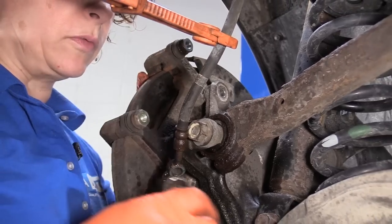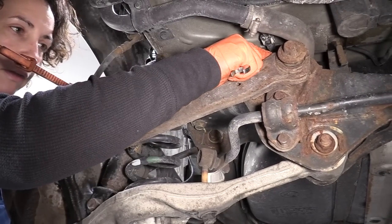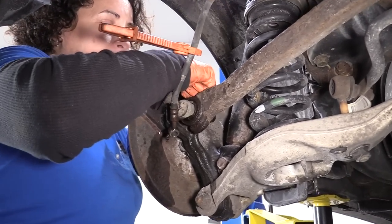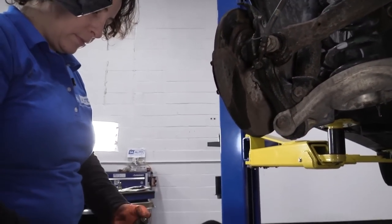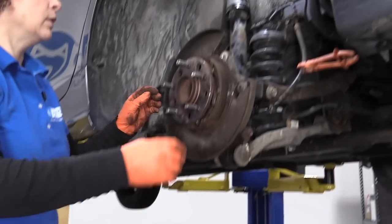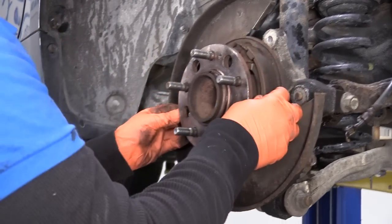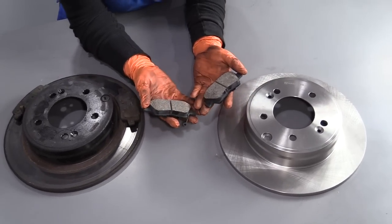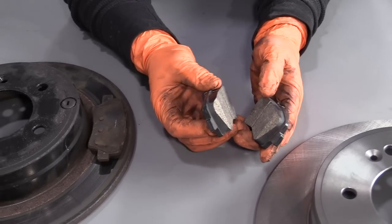The reason I didn't want to remove the trailing arm the normal way is you can see the condition of this arm — the bolts go into the subframe and if that's rotted and rusted, it's going to snap off. The mounting screws for the rotor just use an impact screwdriver bit to break them free. Now I can take the rotor off and we can actually see the e-brake shoes and the condition they're in — they're in good shape, the bonding's not moving, that's a plus. Here we have our brand-new rotors and pads for our 2011 Hyundai from 1A Auto. These brake pads are plenty thick — almost the same thickness as manufacturer's brand-new rear brakes.